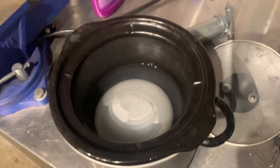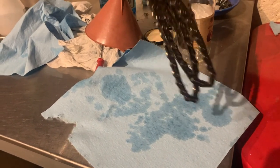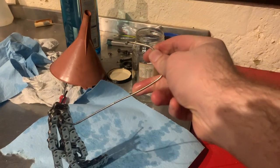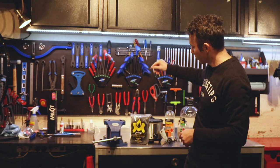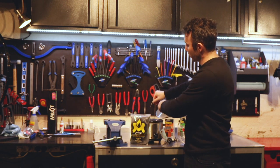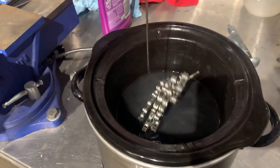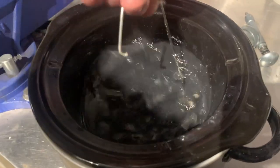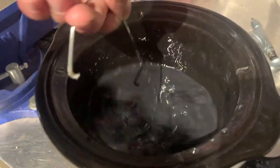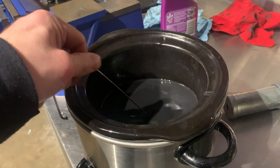To do this I like to grab a little bit of bent wire. An old coat hanger is perfect for this — you use it to loop the chain through, and that chain is then sitting on your little handle that gets put into your wax pot and left to stew. Place your chain onto the top of the wax and allow it to melt in. This can take up to an hour; there's no need to watch it. Once the wax is turned to liquid, use your coat hanger to stir and agitate the chain in the wax. You should see air bubbles escaping as you do this. Let the chain sit in the wax for a further few minutes and then repeat this process again.